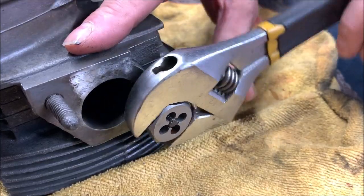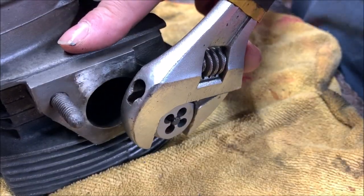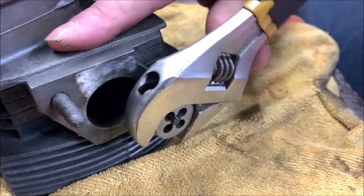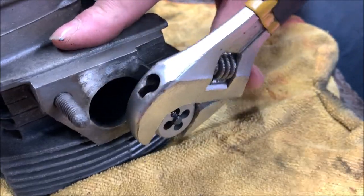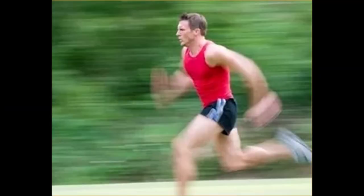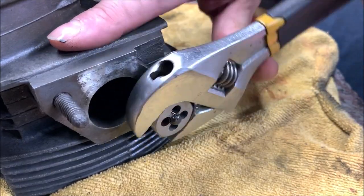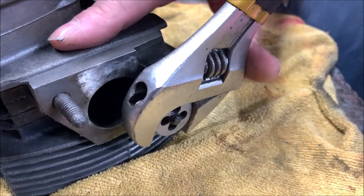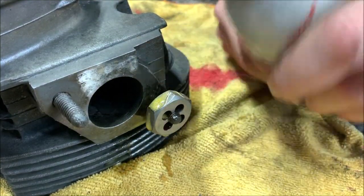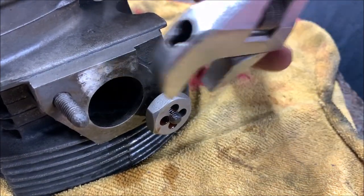I felt it free up. I don't have the right size wrench to fit this - it's pretty big; I even tried a 22 or 21 millimeter wrench, no good. We're gonna keep chasing it - just take your time, move slow, it isn't a race. Looks like somebody dropped it or hit something against it, maybe a hammer by accident and flattened the threads. Give it a little drink - I heard it cutting a little bit, and it's getting a little harder to turn now.